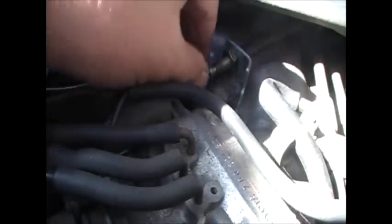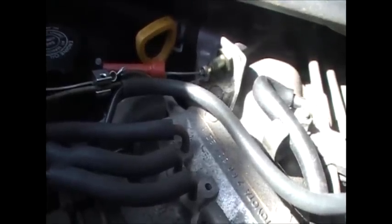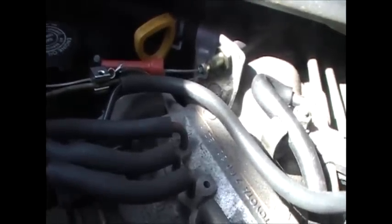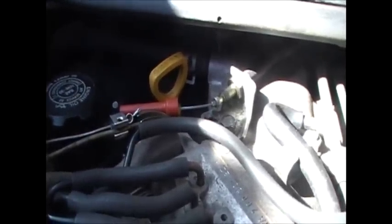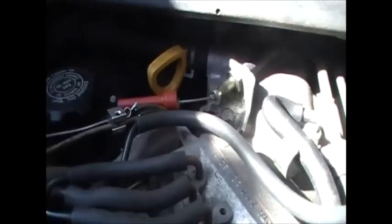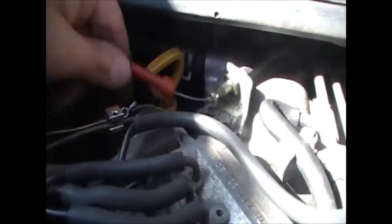And then of course the throttle valve cable is always on full, and the gearbox is being told that I'm giving full acceleration and pumping all the pressure into the torque converter for that type of driving, and I'm not doing that type of driving, and in time that's going to just kill my gearbox. So I don't want that to happen. I need this to reside back. Better to have it back all the way in the van.